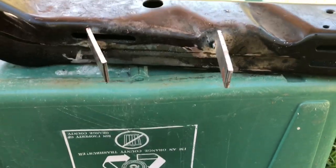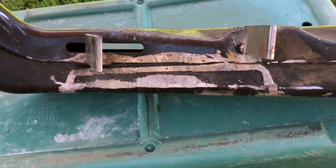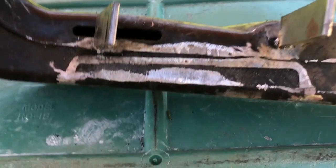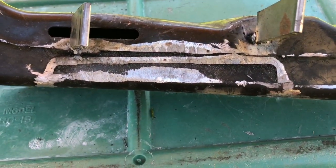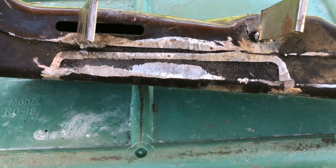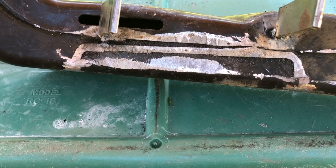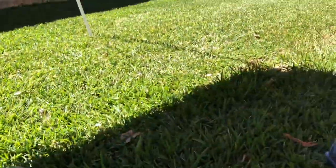Okay, just wanted to show you guys where I'm at here. I went ahead and cut the bracket off. You can see where it was before, and I've welded on these two little tabs. You can see one's actually higher than the other, and that's because down here this bracket, it was the same thing - one was higher than the other. I don't know if it was welded incorrectly from the factory or if that's the way it sits, but I'm going to keep it that way because I don't want to mess up any of the geometry of the way this stuff's supposed to sit here.